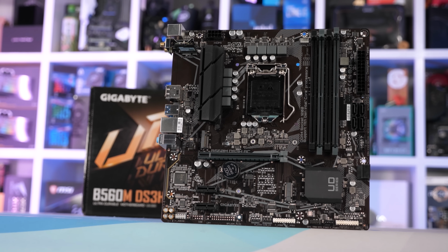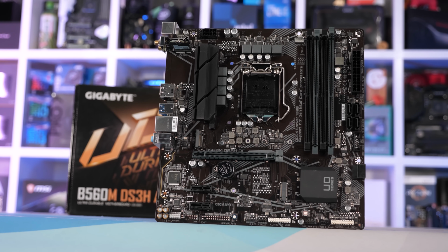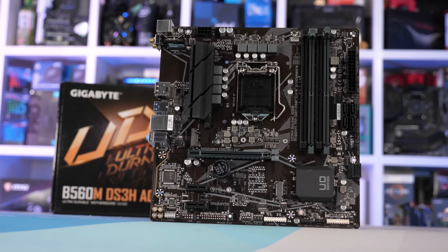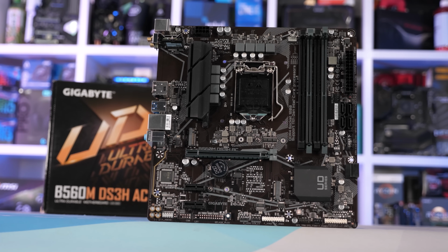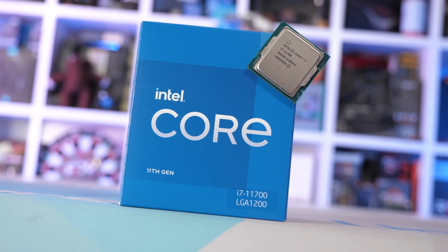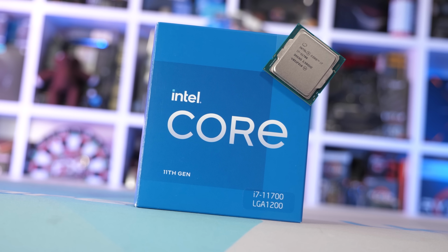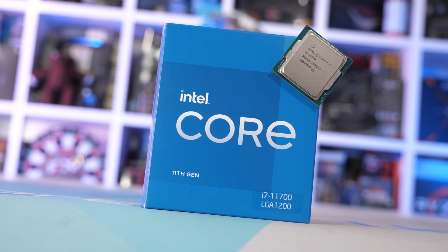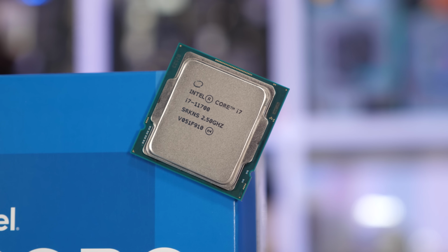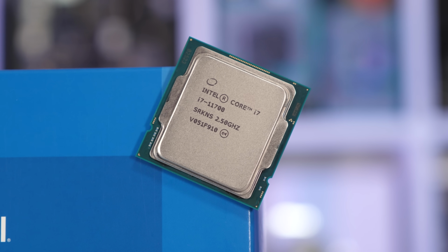So it is correct to say that for the most part, the TDP spec doesn't hurt gaming performance, and therefore doesn't matter to gamers. This is certainly a true statement today, but as games inevitably become more CPU demanding, processors like the Core i7-11700 will start to become more heavily utilized, and with more cores requiring more power, the 11700 will be forced to downclock in order to stay within the TDP budget. And when this happens, games will start to suffer from similar performance reductions currently seen in core-heavy applications.